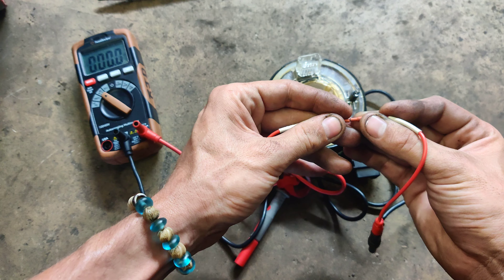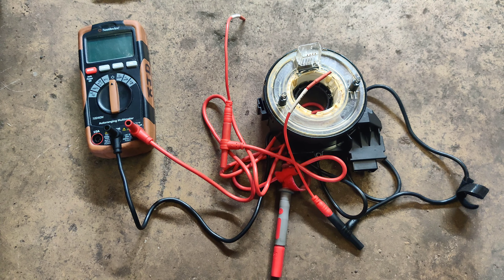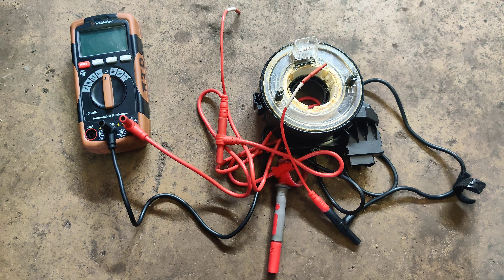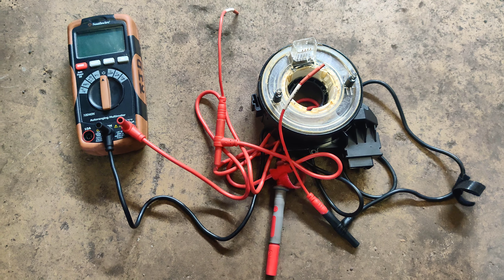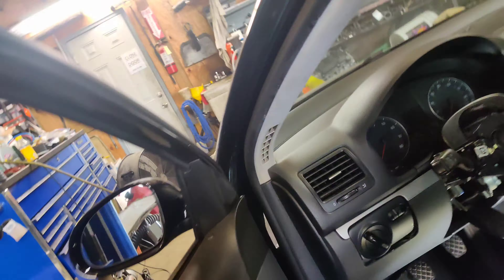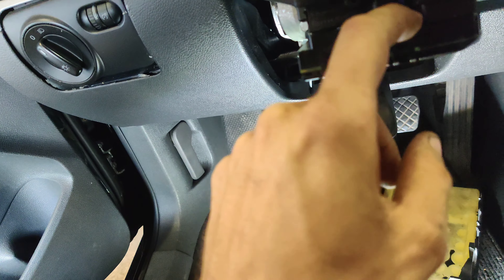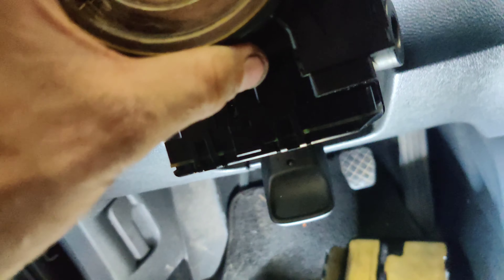And then the horn is going to be these bottom two pins on the left. I couldn't find this on any of the diagrams, I had to just look at the connections. So the horn is also open circuit. Look at this - there's no change. I couldn't find a pin out for the bottom of this clock spring. But if we touch these together, see our resistance drops down. So our leads are good. There's an issue with this clock spring.